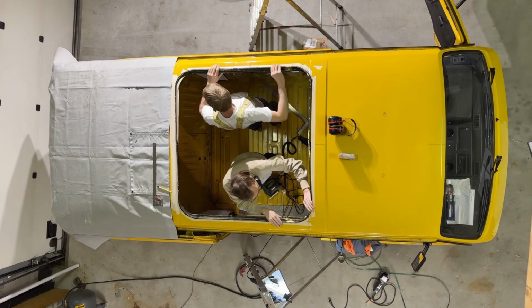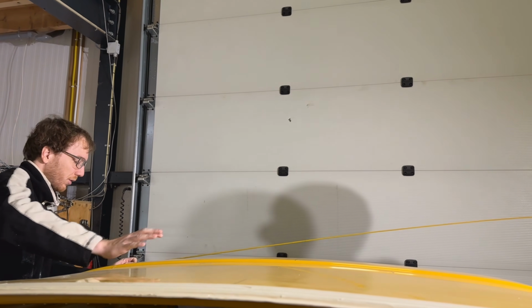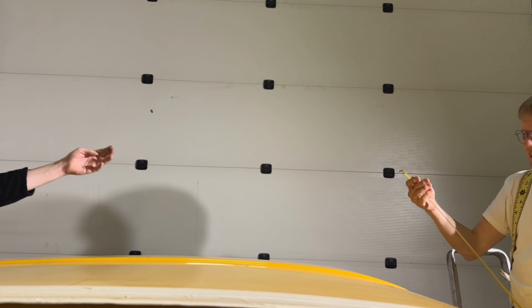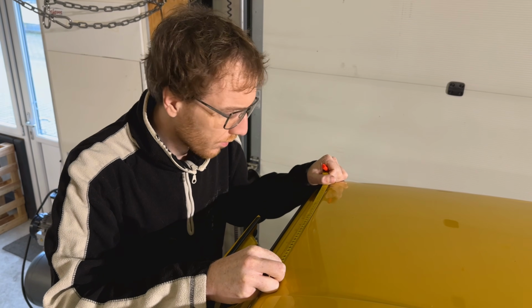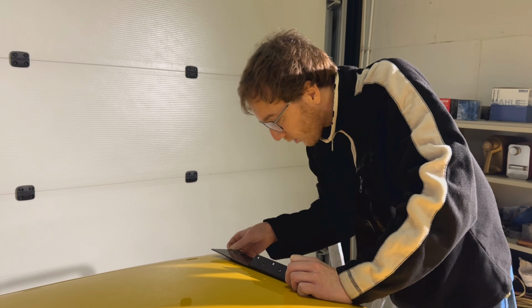We had to go back and forth a few times to make the frame fit, but in the end it worked. Unfortunately, we weren't done yet. A lot of the work still had to happen. The rear hinges still needed to be drilled and positioned on the car. We were lucky enough to have this other car for reference that we could use to drill the holes. Otherwise we could have used a template, of course, but this was a little bit more convenient.